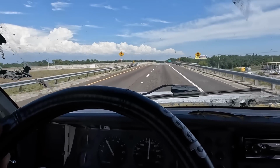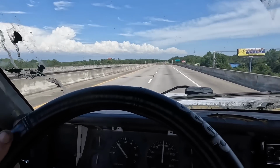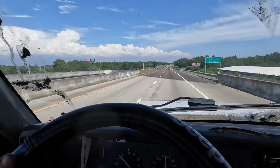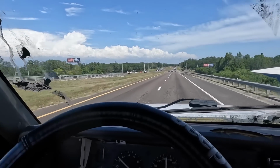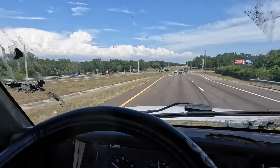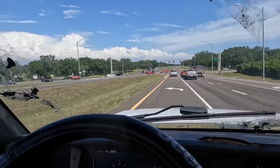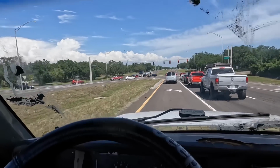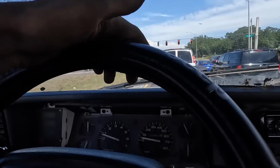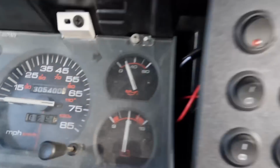So that's either third or fourth or something. I don't know. Steering's pretty squirrely. Yeah, this thing's missing first gear. Yeah, it's got ruined clutches or something like that. Whoa, this thing's hard to steer. Wow. All right, well, at least it moves. We now know that there are more problems with this transmission. I mean, I guess that's to be expected at 305,400 miles on the odometer.